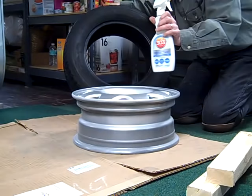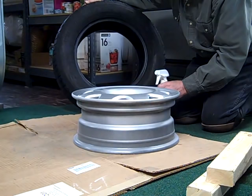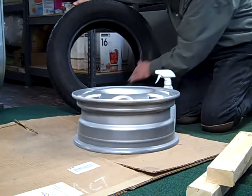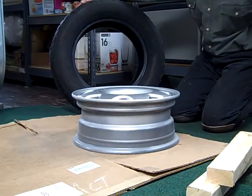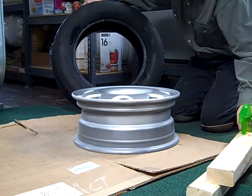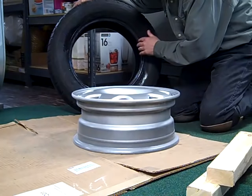The other day I put some 303 protectant on the bead of these older snow tires — I can get one more season out of these. I'm mounting them on some winter wheels, and it makes the bead nice and soft, refreshes the rubber. This 303 protectant is real good stuff. Now, to aid the installation, I've got some soapy water with dish soap. After having put that 303 on there, it makes the bead real slick, which is a key to mounting your own tires.